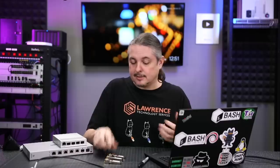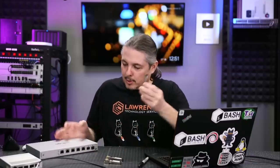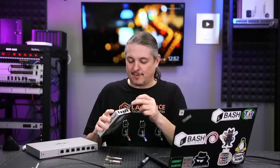Or did you not realize that these don't go the full spec? That's what I wanted to talk about. Using Cat6 and Cat6A seems like a great solution in terms of distance, but when you throw these SFP+ RJ45 adapters in the mix, they don't necessarily work. This UniFi XG6POE has standard 10GB RJ45 ports — no problem, does the distance. But when you start using the SFP+ RJ45 adapters, that isn't the case. I want to talk about the comparison between the three different models I have here and the distances we're able to get with them.